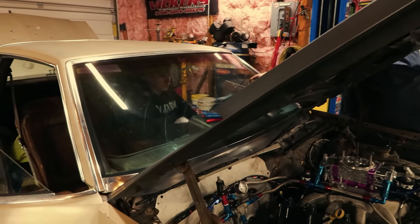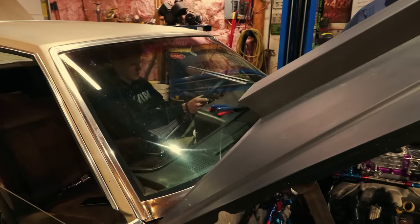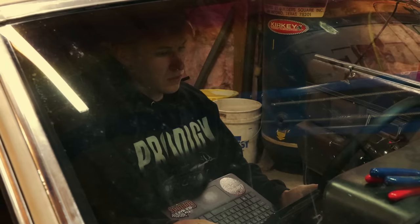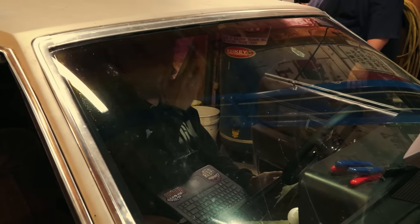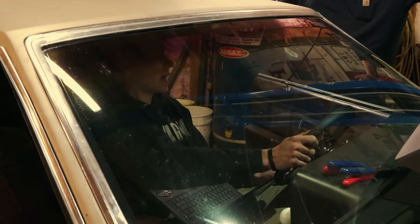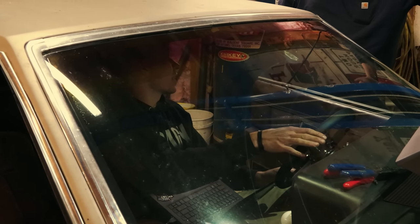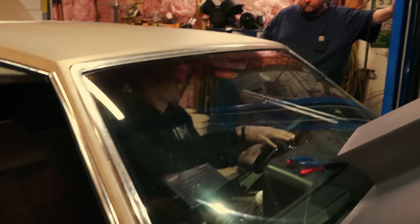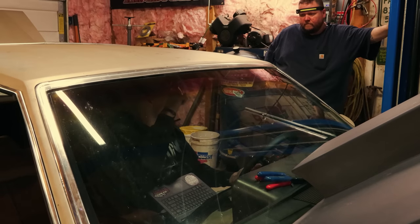This one. It's unhooked now. That's the trans brake button now. Okay, so it doesn't interrupt. Yeah. So what you'll probably have to do for now is go half throttle on the trans brake and kind of foot brake trans brake it. You know what I mean? Or go 3/4 throttle on the brake, let go of the button and then floor it.